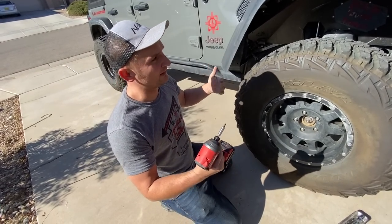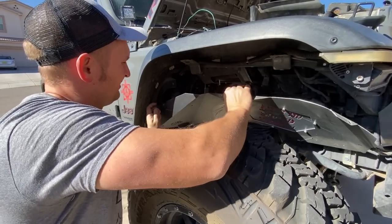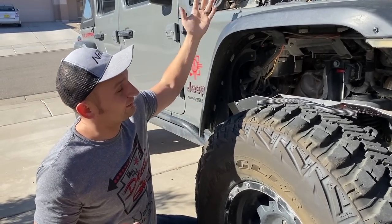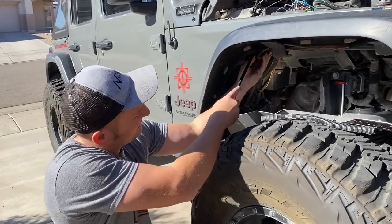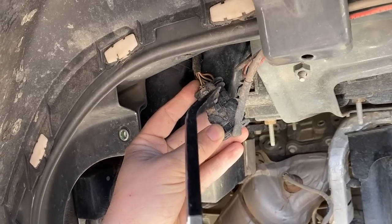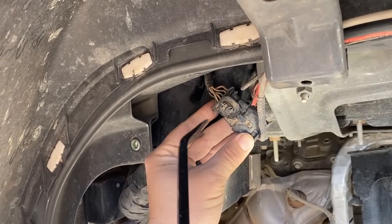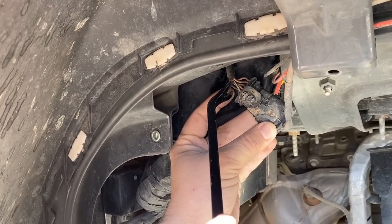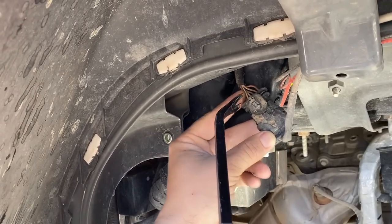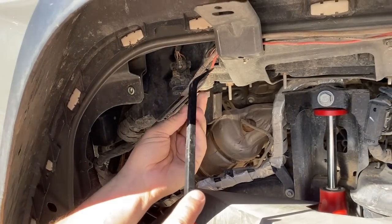You guys remember when I told you things to look for in inner fenders — ease of removing it? Perfect example. The turn signal wire is actually going to be inside your inner fender towards the cowl mounting location. You can come down here — it helps peeling that off. You'll see a cluster of wires in the back. Right here you see a white wire with a green stripe — that is going to be the turn signal, and it's the same on both sides. You can tap in before, though that's really difficult to get to, or you can tap in after, which is what I'm going to do.